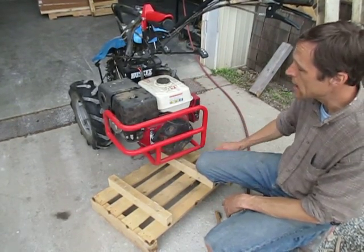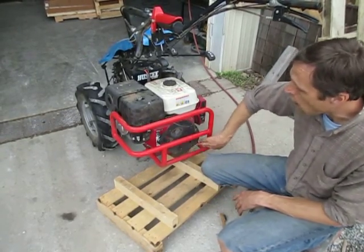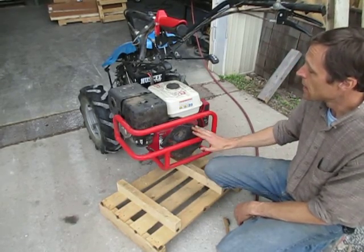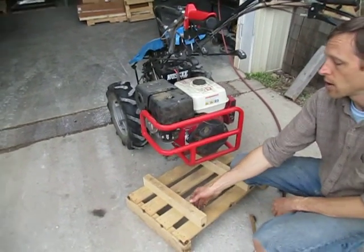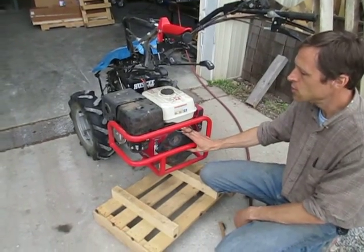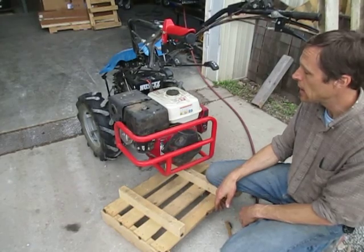Everything builds up right on the screen, and during operation you can just reach down here and brush it off — like taking lint off a lint screen in a dryer. It's exactly the same thing. In the wetter times of year like spring, when you're cutting material with a lot of moisture in it, you won't get a whole lot of buildup. You'll usually see more buildup in the fall when you've got drier, chaffy materials being cut.